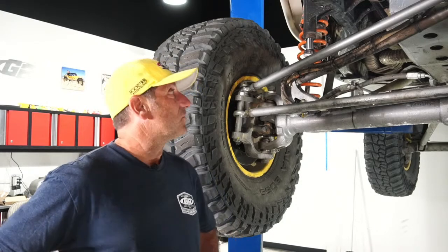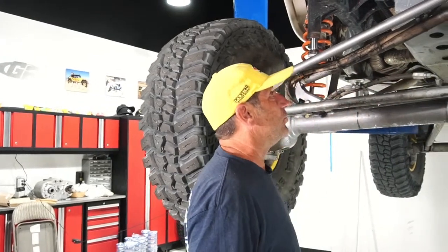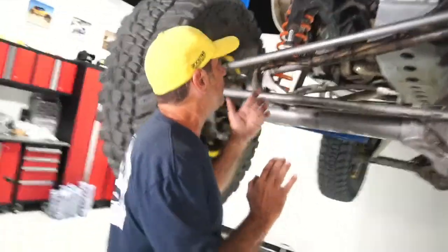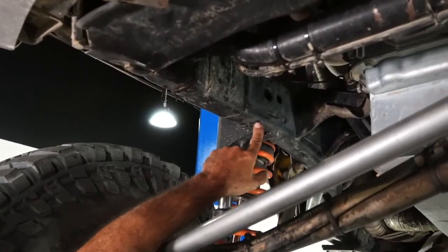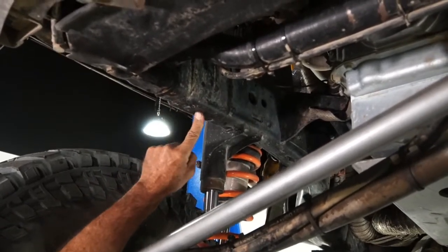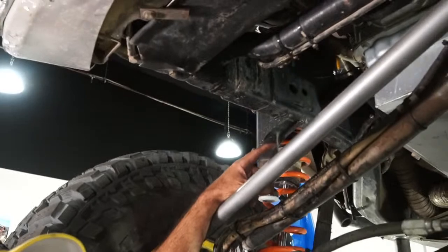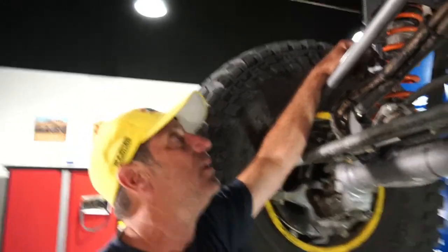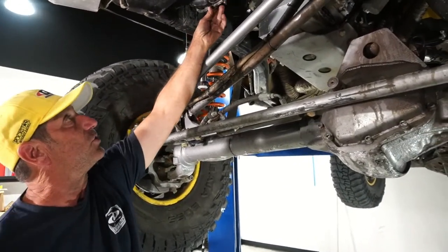A viewer says their frame broke next to the bump stop — yeah, that's common. When you're hammering that bump stop it puts a lot of stress on the frame right in there. You want to look on all sides. On my frame this section is doubled up — the factory puts in an insert and welds around it. Not all frames are like that; later production, like a 2017, thinned some of this out. Also watch for wires rotating around and getting into the pulley.